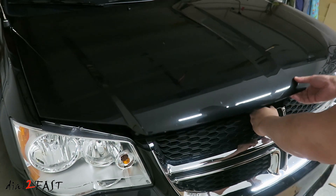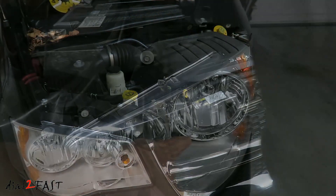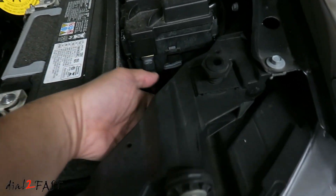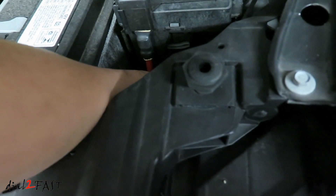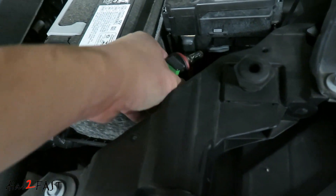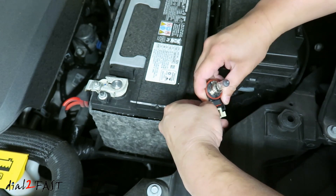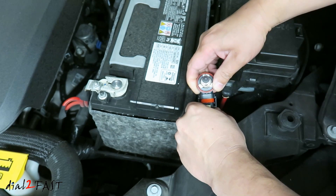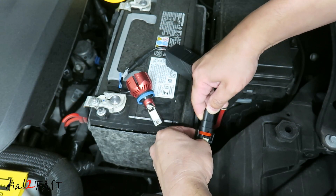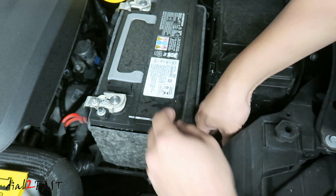To replace the headlight bulb you can reach behind the low beam to access the headlight bulb, rotate it a quarter turn counterclockwise and then remove the bulb. The factory connector has two side tabs. Connect the new LED lights and install the light into the headlight housing.